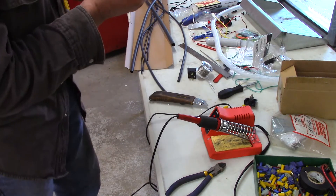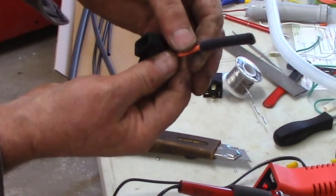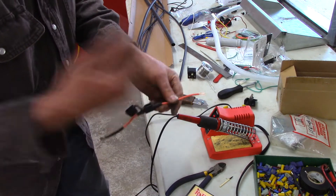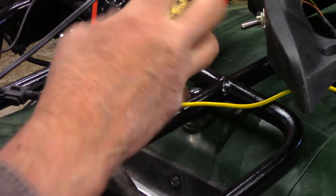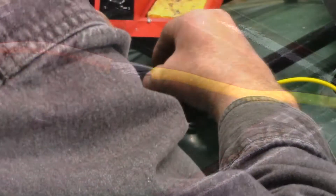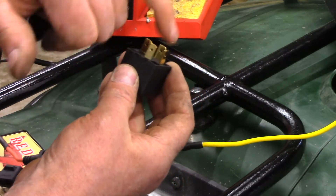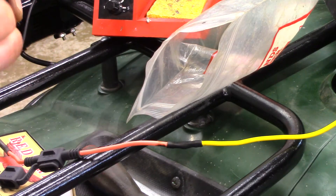The connection won't come off. It's starting to heat up — okay, that's what it'll look like. Heat the shrink tubing evenly; don't keep your flame in one spot or it'll burn. You want it to shrink nicely. Now this is coming from the battery, and I'm going to go to pin number 30 on the relay. Before I put it on, I want to apply some dielectric grease to all my connections — coat both sides of every connection.